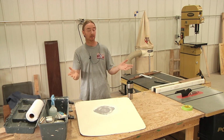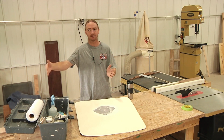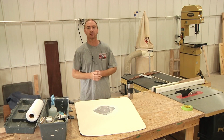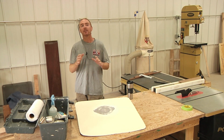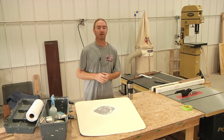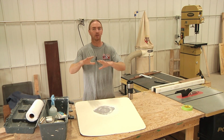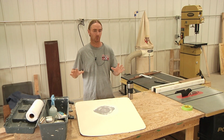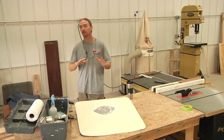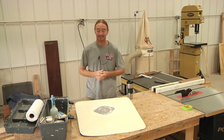When you're looking over the boat as a whole, you don't notice it, because that change is so gradual, and it just shades from one spot into another. That's the same kind of approach you want to take when you're looking to match your gel coat repairs. Get it close enough to where it doesn't jump out at you, and then with the different blending techniques and ways that you can shade it and taper it off, that's where you're going to more or less make the repair go away. All right, so enough babbling. Let's actually get into this here.